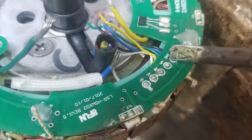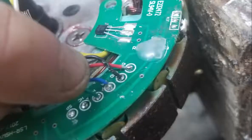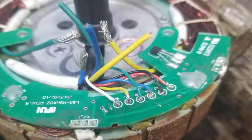Desolder the six old signal wire ends. Next, with the old wire ends out of the way, strip the new ends and solder them into position. Originally the signal wires were soldered in from the bottom of the circuit board; however, it is not easily possible to remove the circuit board, so it's probably best to solder the wires in from above as shown here. Be as neat as possible because there isn't much space to work with.